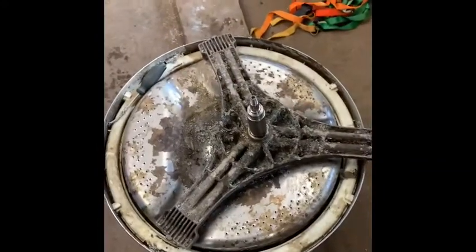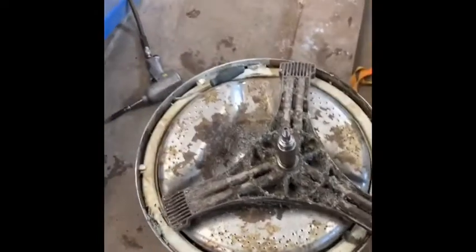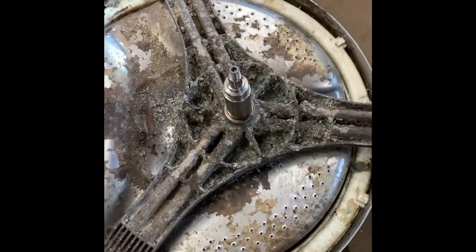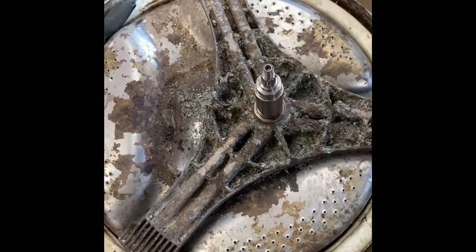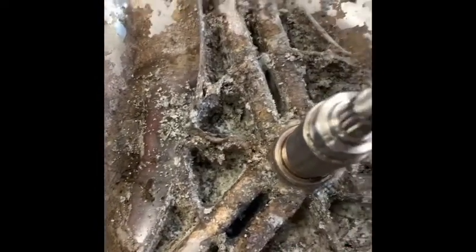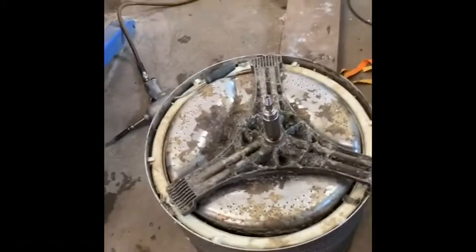I completely filled all the voids with epoxy and sealed the sides with a type of sealant we use in aviation — that's what I do for my normal job, fix airplanes. That fixed it. This one has enough metal left that if I sandblast it nice and clean, I can fill it up with epoxy to strengthen it, and sealing the sides will prevent soap from accumulating underneath. I cleaned it out a little bit with a screwdriver, but it was completely full — it acts like a sponge.